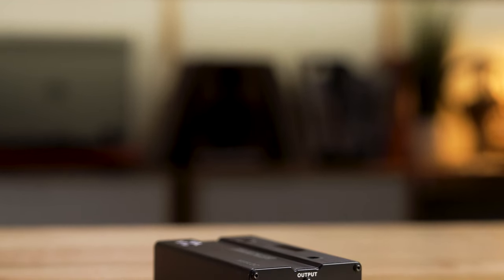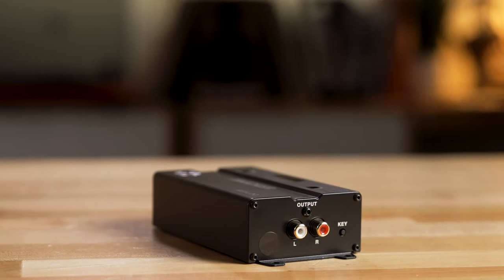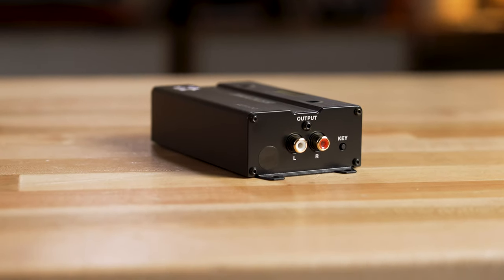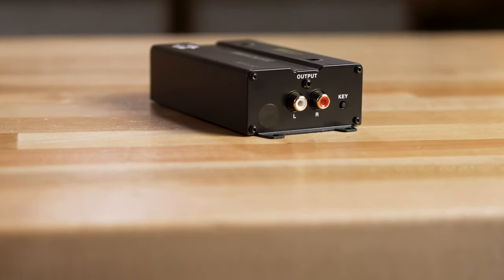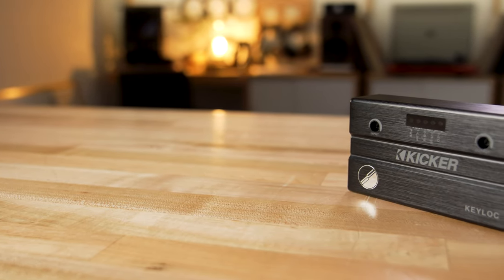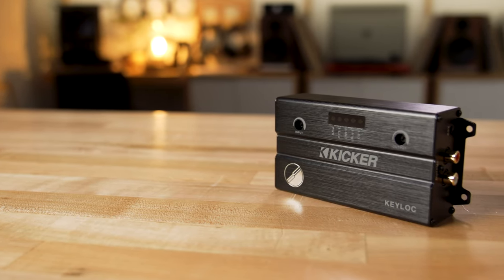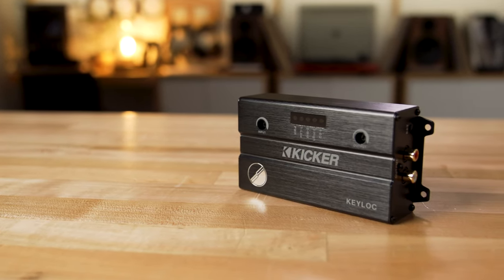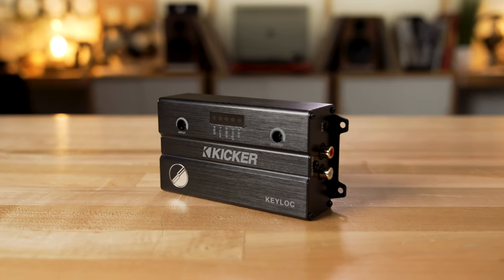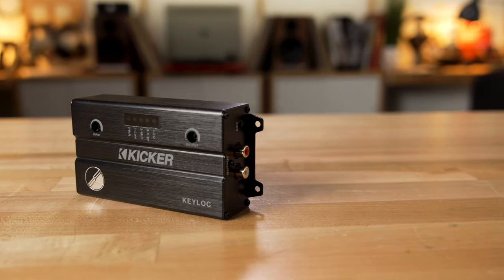If you have a car where you don't want to replace the factory radio, but you do want it to sound better, you're probably going to need amplifiers or a powered sub, something to give the system a little bit more oomph. You're going to need to be able to get music out of the factory radio and into your amplifier or powered sub. To do that, you'll need something to convert that high-level, already amplified music coming out of the factory speaker wires down to a line level or a preamp level, something that your amplifiers can work with.